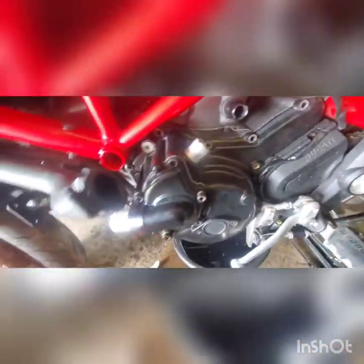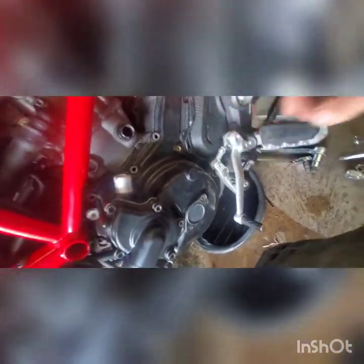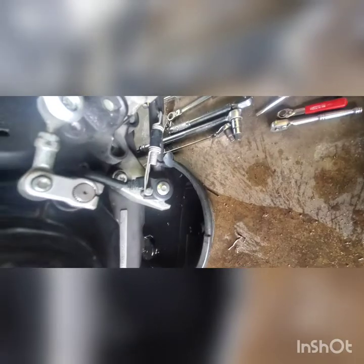For beginners I like to take all of the mounting screws off I can get to right now. There's one or two behind this cover and you also have to take this wiring hold-down off — those are five millimeter Allens. There are eleven I can see and I believe there's two behind the cover, so that makes 13 total. To get the cover off you're going to have to take your shifter off — there's a six millimeter Allen. It's loctited, usually pretty tight to get off. Fold it up out of the way to get to this five millimeter Allen bolt, which has also been loctited.